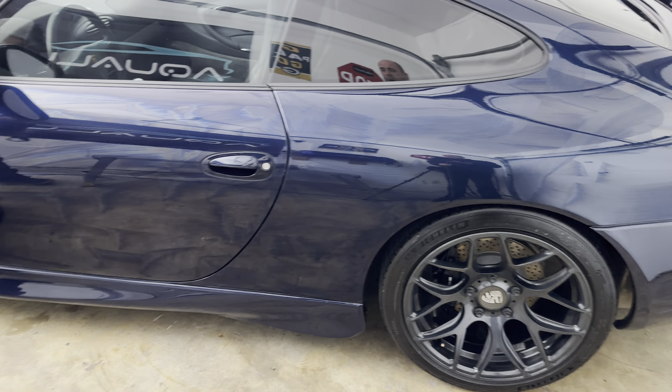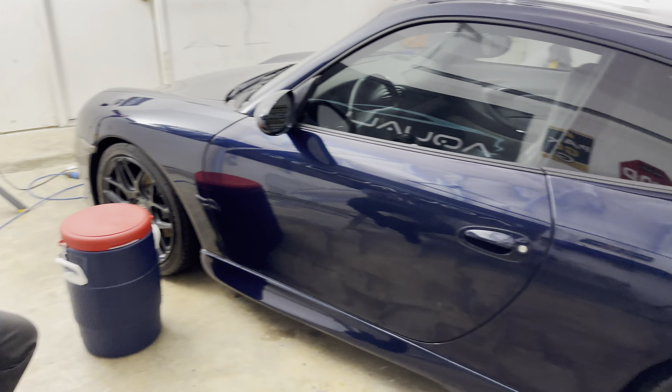You can see the coating flashing right now — you see that rainbow hue all over the paint? If this was a traditional ceramic coating, that rainbow would be our cue to buff off immediately. But with this coating, it's okay — just let it sit, let it do its thing, let it slowly bond. Let the bonding agent bond to the paint. As you're watching it rainbow, that resin load transfer required of all coatings is bonding itself to the bonding agent. This is giving you a very relaxed type of experience.